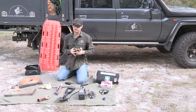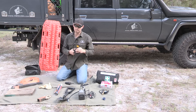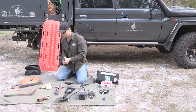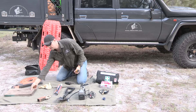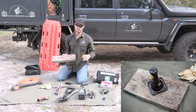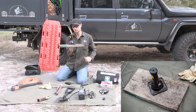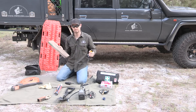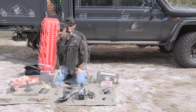Of course, you have your jack in the vehicle. Now, a jack is meant for hard solid ground. When you're in the sand or out in the bush, it might not be level, it might be too soft, and it will sink. Get a board — just a simple board, an off-cut — that'll help keep the jack secure.